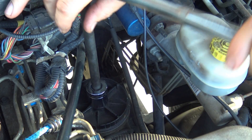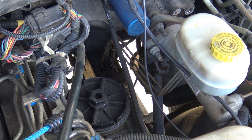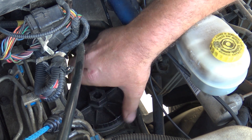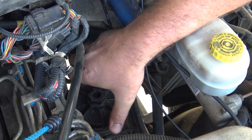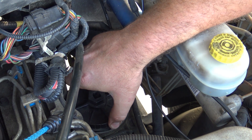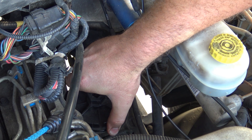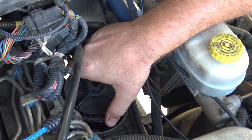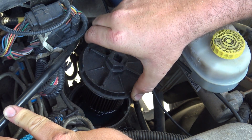There's also a little cable in the way — we're going to take a bungee strap, hook it around, and pull that guy up and out of the way. Now we have a clear shot to our fuel filter. Be very careful, very gentle. It'll come right out — get it loose, and then you can take it out with your hands. When you get ready to take the filter out, it has a rubber gasket, and you're going to spill a tiny amount of diesel fuel. The biggest thing is getting everything out of your way. Lift very gently, very slowly — it's going to pop loose. Nice and easy.